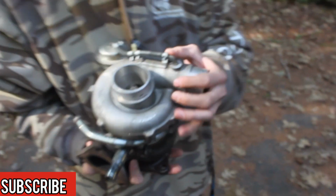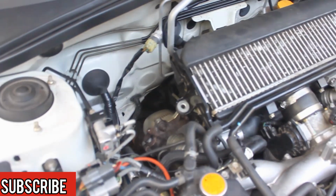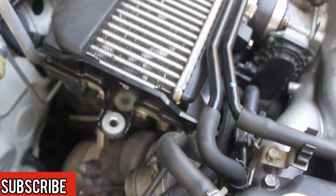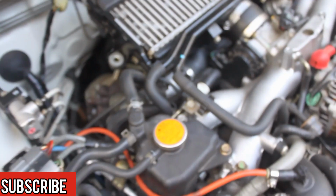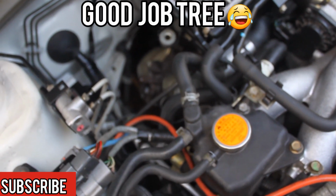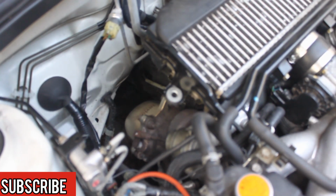And then just so you guys know, we have to change the turbo because he's got a bad turbo up here in the front, which is why in those videos of us doing pulls you could see all that smoke, and especially when you did the anti-lag two-step shot, you can see all the smoke coming out. Basically his turbo seals are just gone. It's the stock turbo from 04 or 05? This car? Yeah. 2006. See, I'm way wrong, guys. It was not 04, it's 06. That's how long that turbo's been in there. So it's time to take it out and put a new one in.